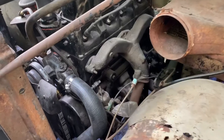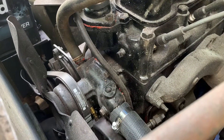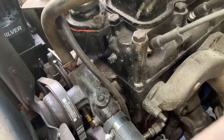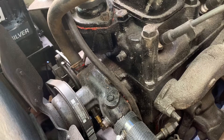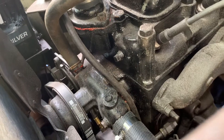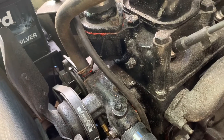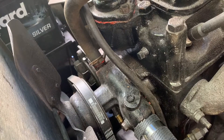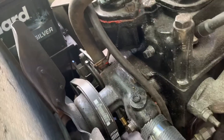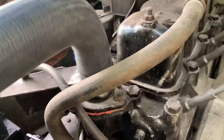Starting with the engine — what I've had to do was replace the water pump. It was a gasket that was bad because of a bolt that had stripped and had a raised burr, and it was causing it to leak. It basically sat there and dripped all day long because it's on a slight incline. So I took it off, filed down the burr, drilled and tapped a new hole, got a new gasket, and put the water pump back in — which was a real pain, but it's in now. I also replaced some of the hoses, put a new thermostat in, and put it all back together.